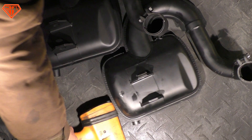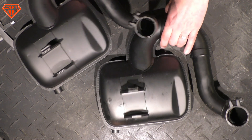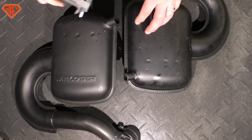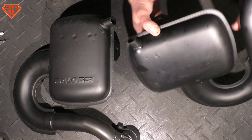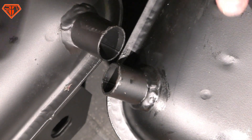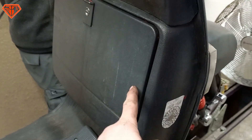We don't know how it is inside. It has decent power, the FACO Box — not as strong as the Polini Box. The only difference we have here is the tailpipe. And that's what I thought when I heard Malossi is made by FACO. The FACO Box has a 17mm tailpipe — seriously, that small. It's like an original box, but it's not appropriate for tuning. Malossi is 20mm, FACO is 17mm. That is the difference, mate. That's the difference between these two boxes. I cannot find anything different than the bodies, but the tailpipe — Malossi: 20mm, FACO: 17mm.